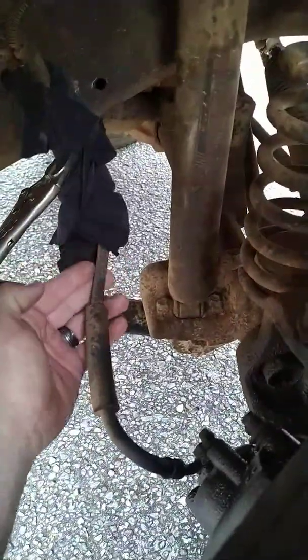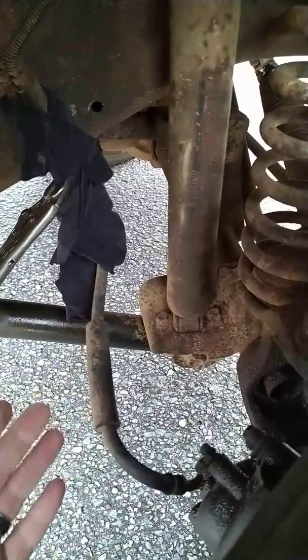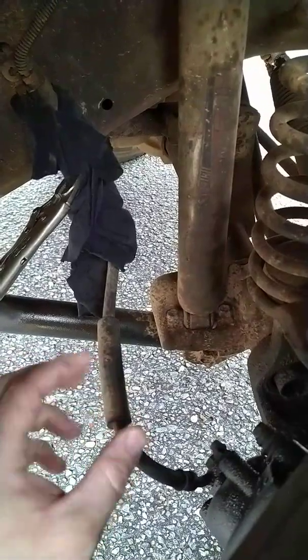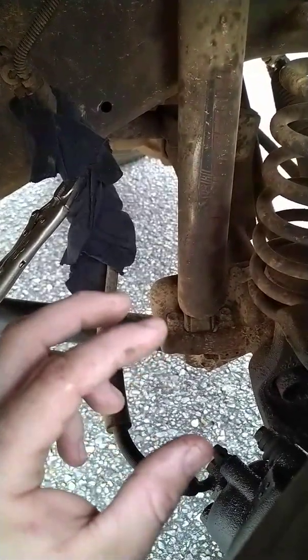So far, so good. I'm not seeing any leakage down here on the line — no wetness, and that's good. If you see wetness, you need to get somewhere fast, because you're going to start getting air bubbles in this line, and that's going to affect your other brakes. Air bubbles compress; hydraulic brake fluid does not, not nearly as much as air bubbles do.